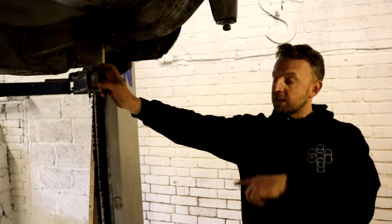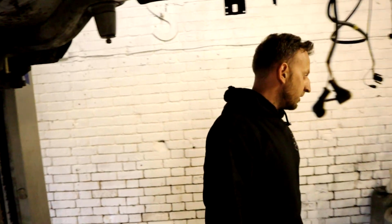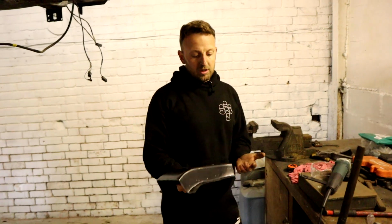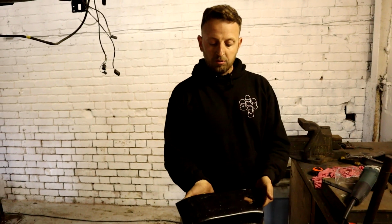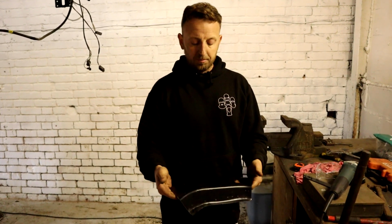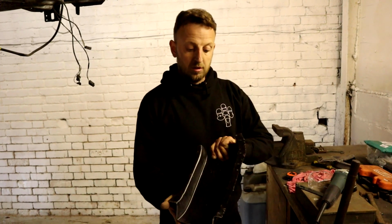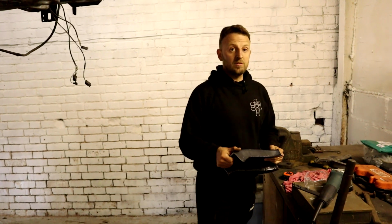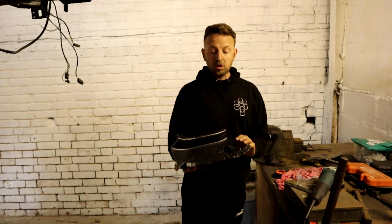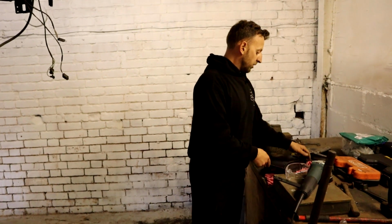So Jack and Dave will be cracking on with that, and then I can keep tweaking and fitting, because you don't want to watch me tweaking and fiddling with panels. The only reason, if this was a genuine part cut out of a car, it would fit perfect, because it's an original part. People might say, why are you chopping up a good shell? It isn't a good shell, but you're better off getting good parts off a genuine shell to use on yours. If you get pattern parts, they will work like copied parts, but you've got to mess about and fiddle with them, and you'll spend hours doing it. It'll work in the end, it'll be right.